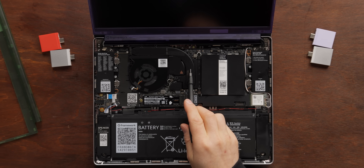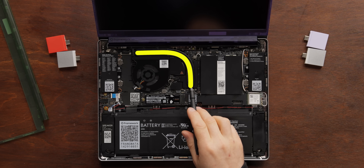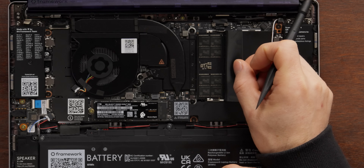That is a big difference inside. They've gone from two 5 mm heat pipes to a single 10 mm heat pipe in order to handle the additional thermal output of this Ryzen 9 processor. And there's the RAM — 96 gigabytes of DDR5 5600 mega-transfer per second on SODIMM modules. So if you ever needed to upgrade, you could. Or if you want to start with a lower amount of memory today and upgrade to a full 96 gig configuration in the future, you could do that too.